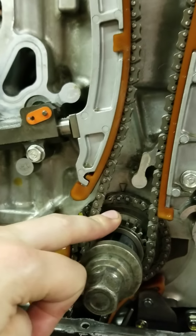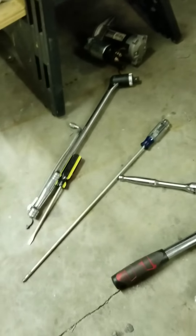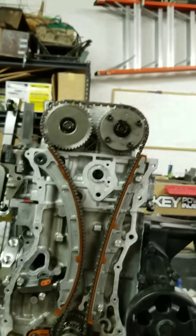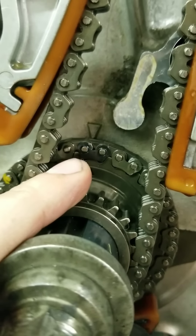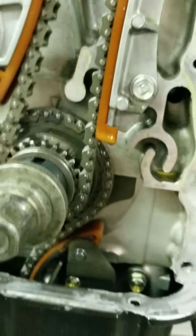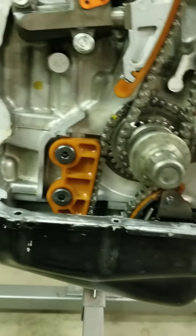We're going to follow that down to the crank. What you want to make sure is that your crank has cylinder one at top dead center. I use a long screwdriver with the bottom taped up nicely so it doesn't scratch anything. I turn the engine over and make sure the screwdriver is at its highest point before it comes back down. You'll also see the arrows lining up down here, and I've got the black chain again — that one's for the oil pump chain.